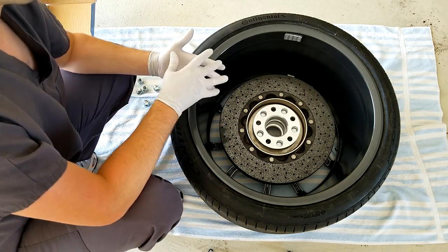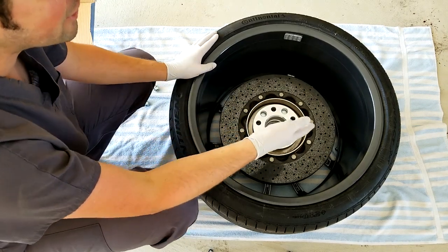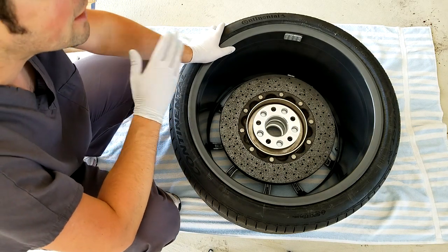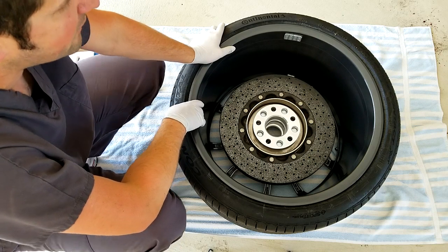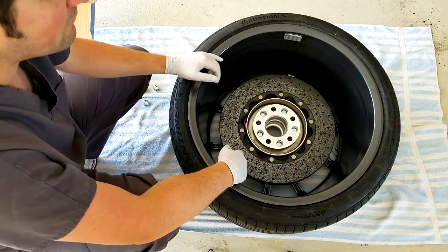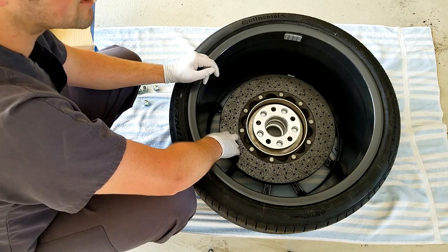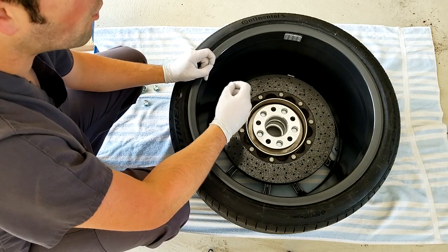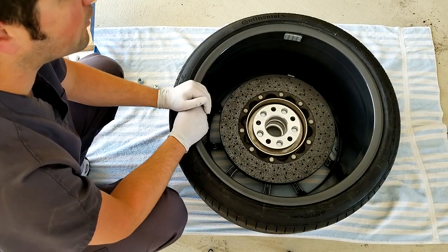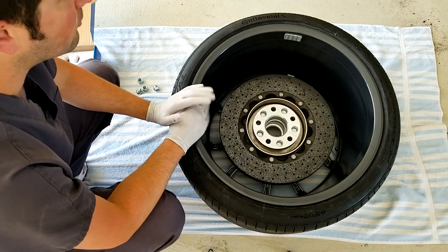There is also a TSB that Aston Martin made — a way they attempted to do something similar. I tried that TSB, which basically tries to counterbalance the wheel to the rotor using some fancy trickery. I tried that method first and it didn't work for me even when I did it completely perfectly. I might throw the link in the description for that TSB. You basically find out with the rotor on the balancer by itself how much the rotor is out of balance, and then counterbalance the wheel by that amount. The downside is that tire balancing machines are not sensitive enough or able to properly balance a rotor alone since there is not enough rotating mass — that's a lot of what the issue was.